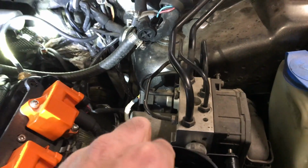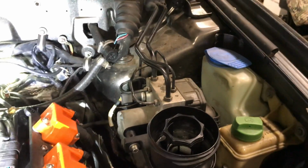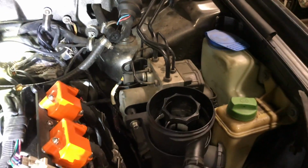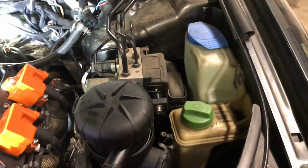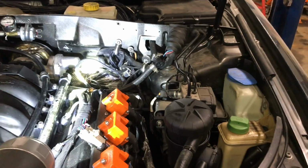Anything that's vapor gets filtered, and the liquid oil runs down. There's a line that comes out of there at the bottom, and you can either plumb that back into the oil pan. I don't. I have just a stopcock on it, so I periodically check it. And then it has a one-way valve here that controls the airflow.